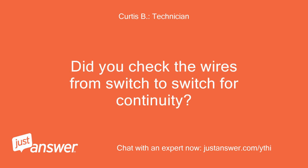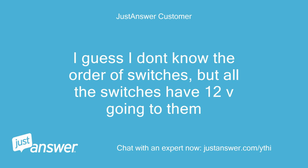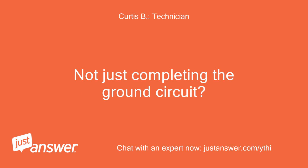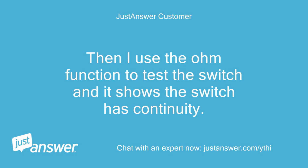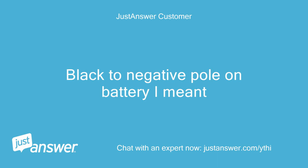Did you check the wires from switch to switch for continuity? I did not, I just checked for voltage from battery to each and checked continuity through the switch. I guess I don't know the order of switches, but all the switches have 12V going to them. Toro is running voltage to the safety switches? Not just completing the ground circuit? Here's my problem, you're speaking over my head. I touch black on the voltmeter and test the harness going to the switch, and it'll say 12V. Then I use the ohm function to test the switch and it shows the switch has continuity. I don't know how to test ground. Black to the negative pole on the battery, I meant.